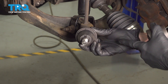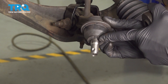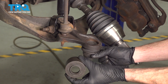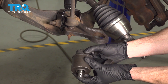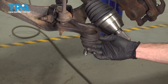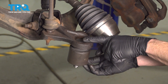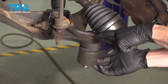Let's prepare to install our brand new ball joint. Before you put this into the vehicle, have a look at the boot itself. You'll find that there's an area on the tip of it that has a little notch carved out. We want to make sure that we have that notch facing inboard, towards the engine. Let's take this ball joint and put it down underneath the lower control arm, making sure that's facing inboard. We're going to use ball joint adapter tools — we want to find one that goes directly over the boot but presses on the base of the ball joint. You don't want to crush the boot — you just want to get up against the base all the way around. Now take that ball joint with the notch facing inboard and put it down underneath the lower control arm. Take that adapter, put it right up against the base, making sure we're not damaging the boot. As we start pressing the ball joint up through the control arm, it's going to protrude a little bit above this area. It's important to make sure you have a cup that fits just over the top of the control arm, leaving an area for the ball joint to come up and into.